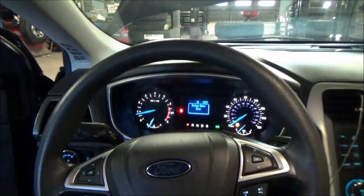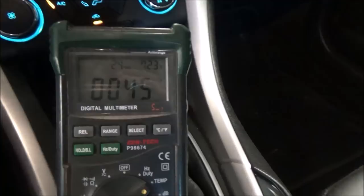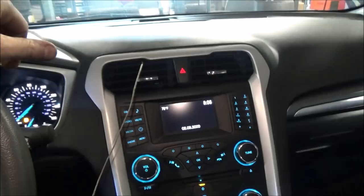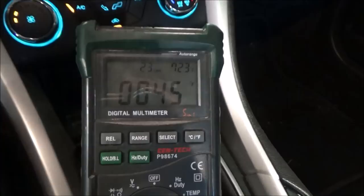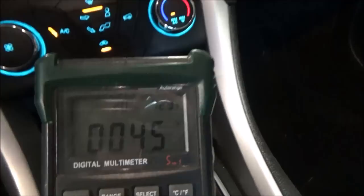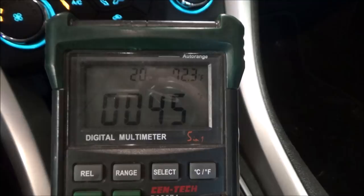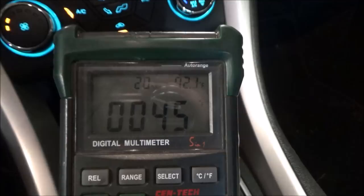Back inside the car now, AC is on at a pretty low fan speed for noise purposes. Taking another look at my meter — just a Type-K thermocouple going right into the center vent. This isn't the best way to check vent temperatures; the best way is to use a dial thermometer, but I can't find mine so we're opting for this. Remember before we were blowing out ambient air — it was around 90 to 99 degrees after a pretty good hot soak. Seeing that this is now saying 45 degrees — pretty sure you can tell that's a huge difference. I'm going to hold the engine RPM up a little bit to see if this number reacts. Using a thermocouple like this is more just for perspective purposes so you can see the change, the before and after compared to what we had before.